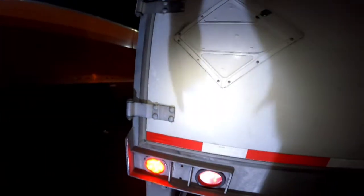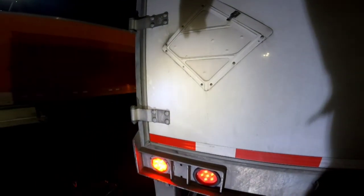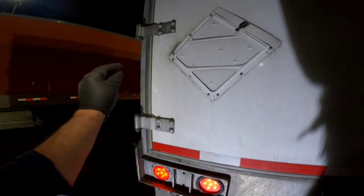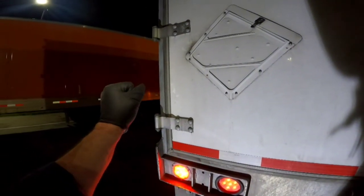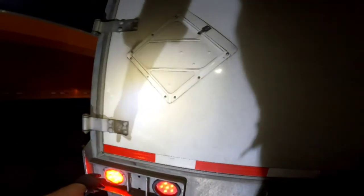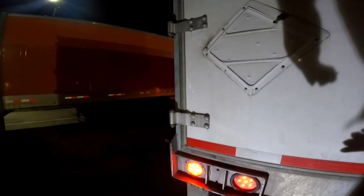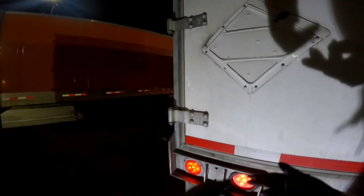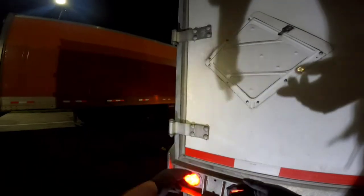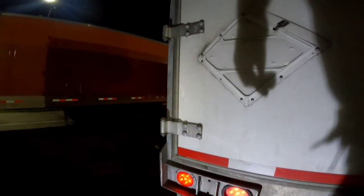And then I tracked the wire, 2 wires. One was unplugged, so every time I pushed on it, it arced and it was flickering because it was actually kind of working, but it was dim, so I had kind of a ground on the left side. When I got that out and I put my hand in there and started doing stuff, it didn't work at all anymore. So I had to track the wire for the wire harness plug for that. I found that finally, and plugged that back in, which is for your ABS because your ABS light wasn't working. I didn't even notice that part.